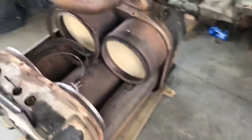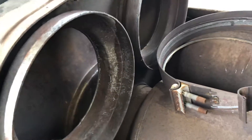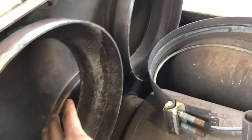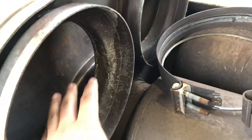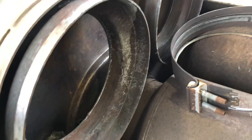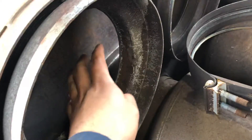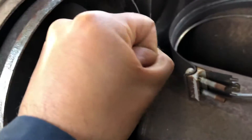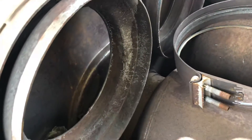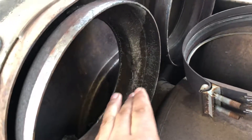If a technician removes your DPF filters and tells you to just clean them, but you can see soot in there, it means your filters probably won't last. They might clean it and it might work for a while, but it's going to keep building up. I suggest changing the DPF filters as soon as you can — it might be costly now, but in the long run you won't have a breakdown on the road.